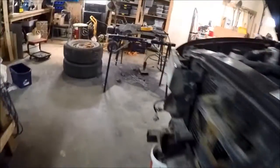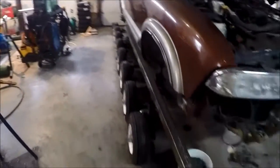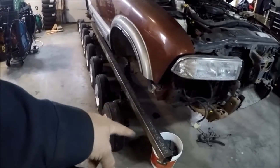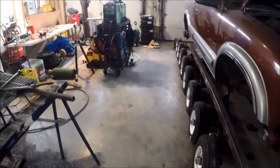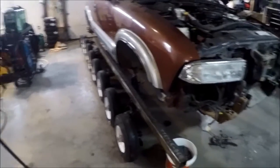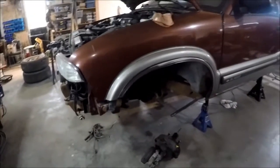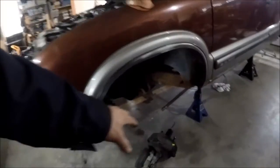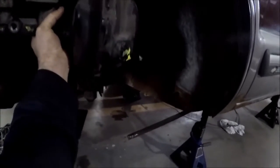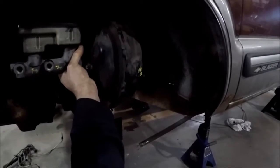Got to run back to the picker part and get some brake bolts and another hose. That's one side — it's pretty close. We'll keep mocking this up, get the back end put together, start on the front adjuster wheel, then drill more holes in the track and assemble the track to see if it all fits. Before starting the other side, we'll get the brake system done — the brake drum, brake cylinder, and master cylinder — mounted so the track doesn't limit access underneath the vehicle.